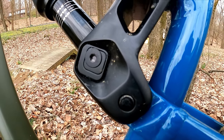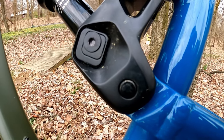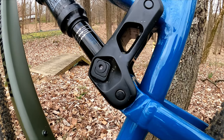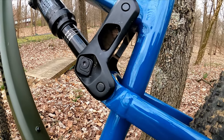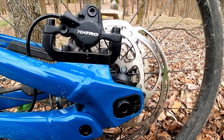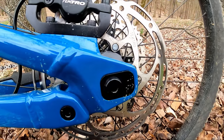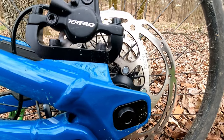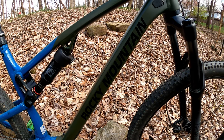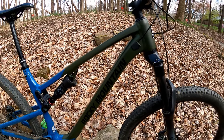I've also got my ride 9 setting going on the 6th position because that gives me a little bit steeper head tube angle, but position 3 is also a progressive setup. So it gives me a little bit progressive suspension and a steeper head tube angle, which is good for the type of racing I do. I've also got the 2 axle position adjustment in the rear, but the 2nd position, or the far one, is pretty long. And it's probably mainly for steep, fast downhills when you're in the World Cup, kind of like that. The bike also weighs around 35.2 pounds. That's about average, so it's a really good climber for its weight.